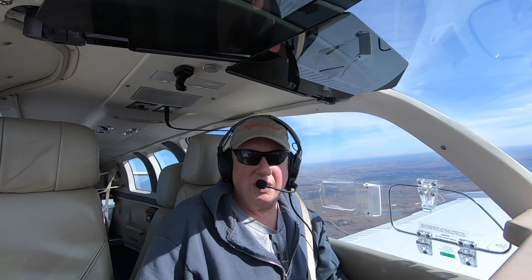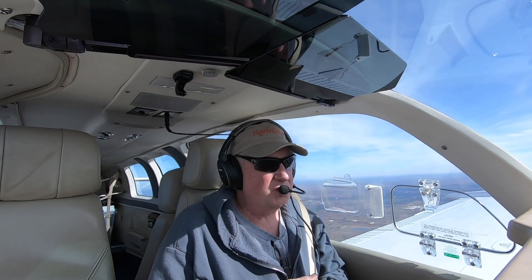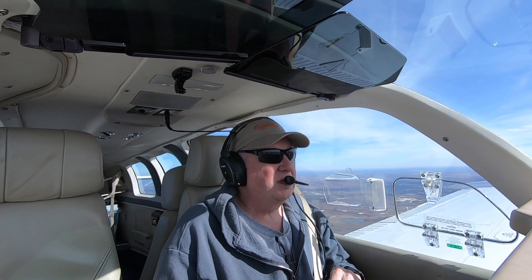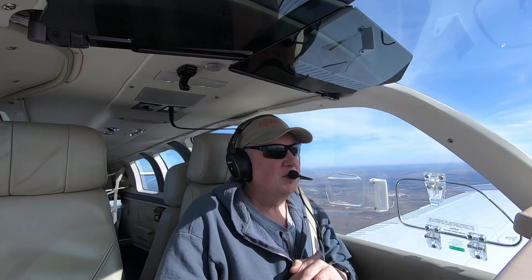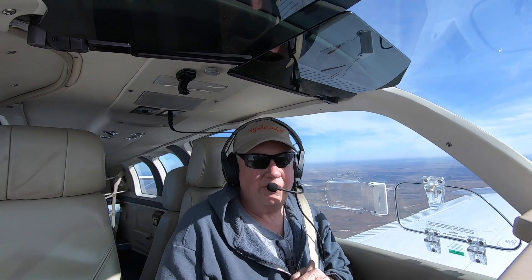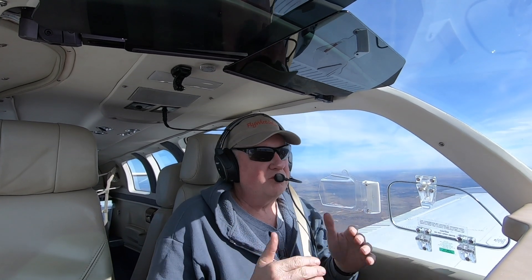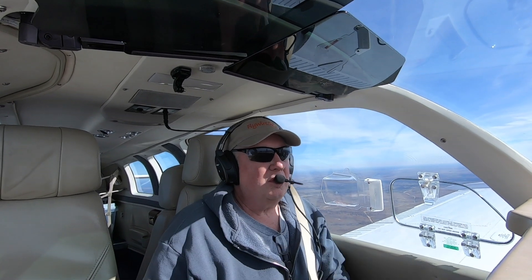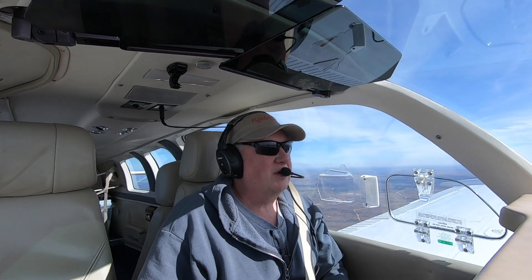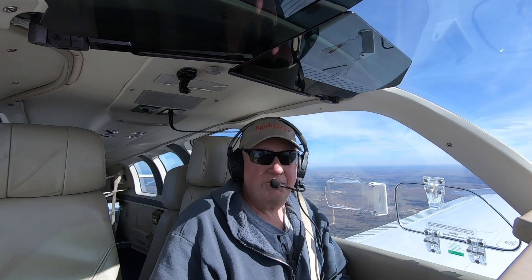I think that's a pretty good test. It seems like the autopilot is working — it's a bumpy day, so it's moving us around quite a bit, but it's pretty well handling the altitude. Not perfect, but pretty much standard for a KFC 200. And I'm not getting any of those weird, wacky inputs to the autopilot, and the PFD is not rebooting. So I think we have solved that problem.